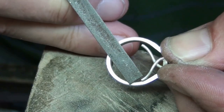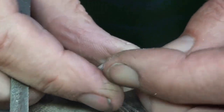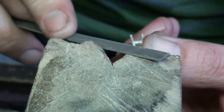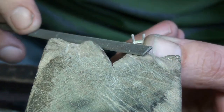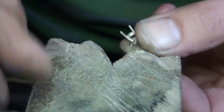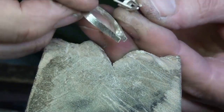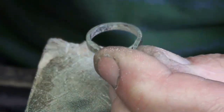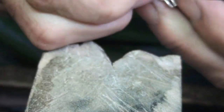It's on the shoulder, just on the rail there, so it's nice and flush. From that angle I need to keep filing until I get to a point. I'll do that on both sides, and then I'm going to emery clean the inside, because once it's soldered together it's going to be too hard to get to. Now it's fitting better but I've got the wrong angle on the other side so I'll just change that.